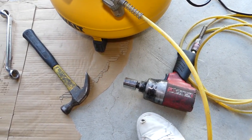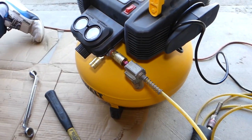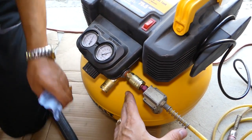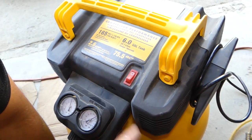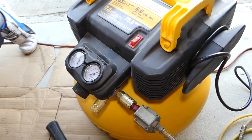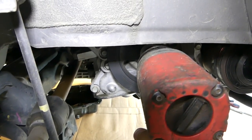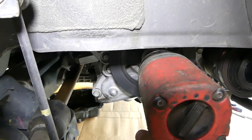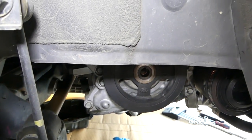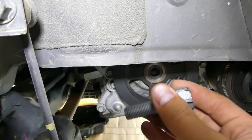So we use that impact here now, half an inch impact. Pretty powerful. All the tools that we use will be listed in the description of the video below. The compressor, that little pancake compressor, goes all the way to 165 psi. So it will be amazing for that job because it will give us quite a bit of boost in the beginning so we can remove that bolt. Like counterclockwise now to try to get the bolt loose. Okay, and you can see with just a little bit of air, okay, that crankshaft pulley bolt came out.